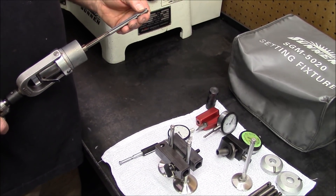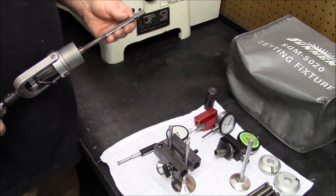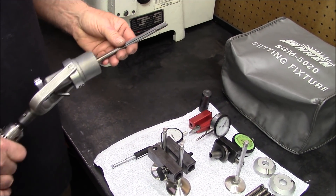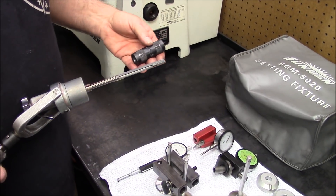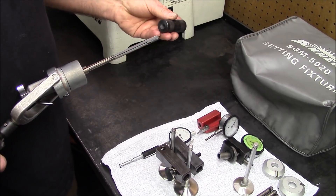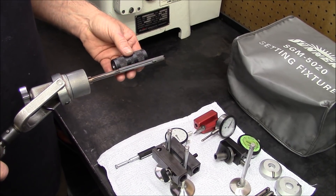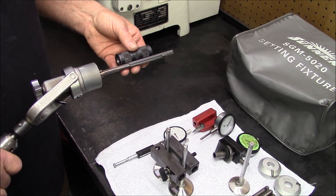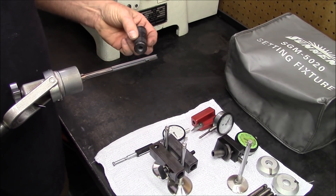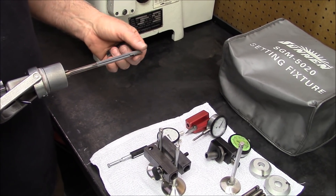It gets kind of messy because you're honing 12 to 16 valve guides between two heads. Before we put this into the valve guide to hone it and stroke it, we'll take this truing sleeve and set it up. Hit it with some WD-40 or even a little bit of hone oil — you don't want much on it. Then you're going to stroke this hone in and out of this truing sleeve, counting the strokes. Say you stroke it five times, then you flip it and stroke it another five times. This trues the stone up so it's ready to go into the guide.